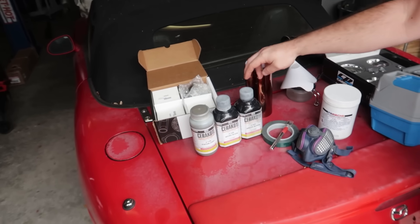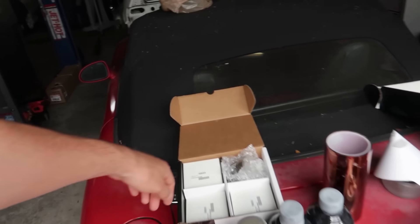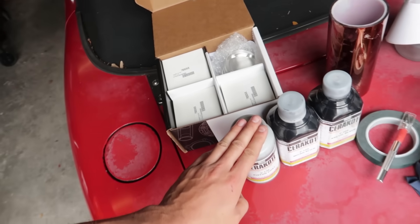The last coating is the Arctic black, which is for your radiators, intercoolers, and so forth. That's a special compound designed for absorbing heat. So today with my pistons we're coating the tops because my Wiseco ones already have the side skirts done, so we'll be putting the piston coat on those.